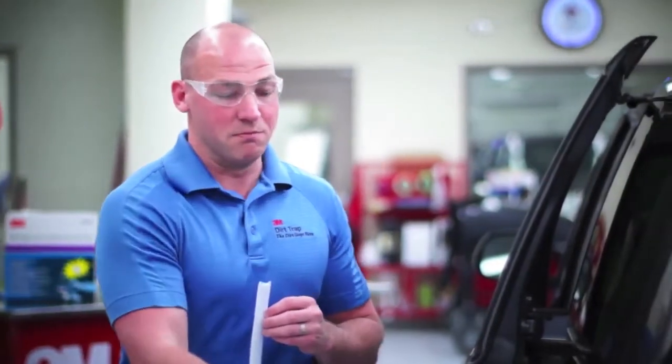Hi, my name is Mark Kitwell and I'm here today to talk to you about the Soft Edge Foam Masking Tape Plus. A couple of key differences between this foam and the traditional foams are that the adhesive is offset. That allows you to be able to stick to the moving part rather than the stationary part and keep the adhesive away from the paint line.